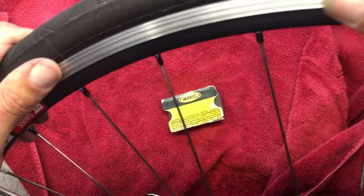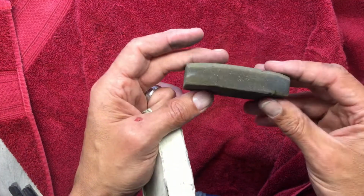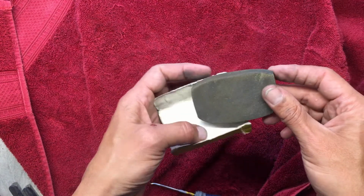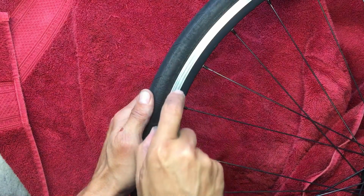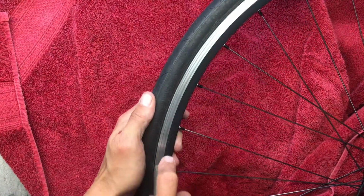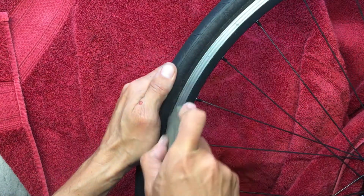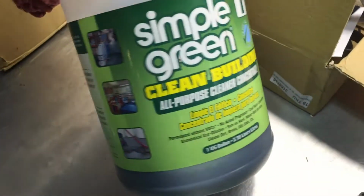Anyway, this rim here has got a little bit of roughness from the little metal bits that we're digging in there. So what I like to do here, after I get the pads resurfaced or replaced, I'll take some either really fine sandpaper, or I like these Mavic little soft abrasive stones, that I'll put a link to where you can purchase that. But those work really well to basically refinish the surface of the rim, get all the rough spots. Again, you could use a fine grit sandpaper, but these seem like they really are easy on the rim.